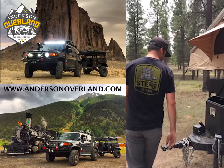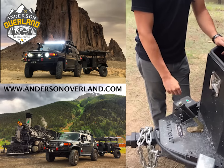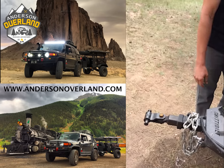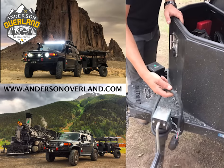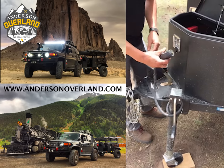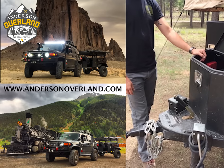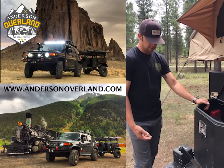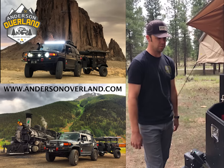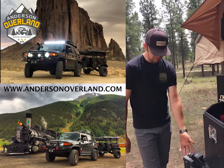We'll just start in the front. This comes with a breakaway braking system with a battery and a charger. It's 12 volt and connects right up to your trailer hitch via the plug. I installed it when we built the trailer but I never use it because I just don't feel like I need it — I don't have enough weight in this thing to really have a huge need for a breakaway system, but it's there. I just unplug the plugs in the back and tape them up so that when there's no electricity going to this thing, the brakes aren't activated. Anyway, it comes with the breakaway system, which is a cool feature.